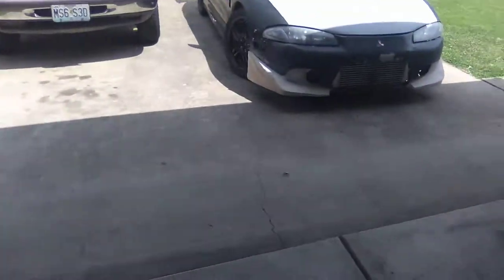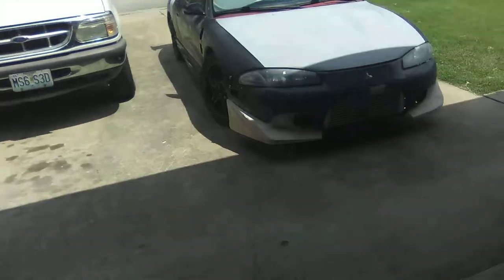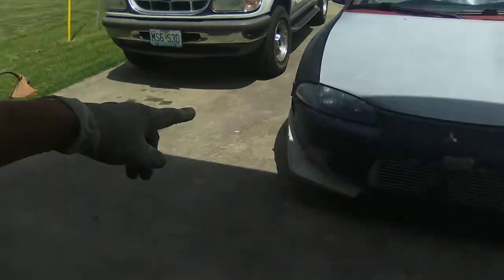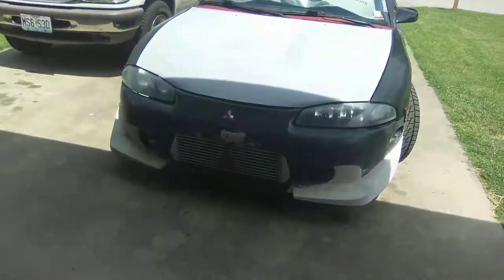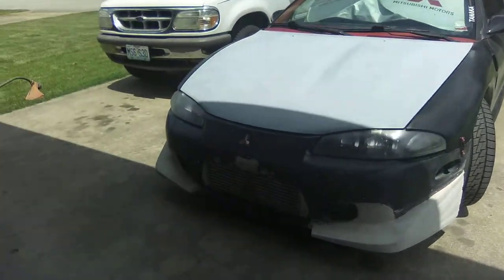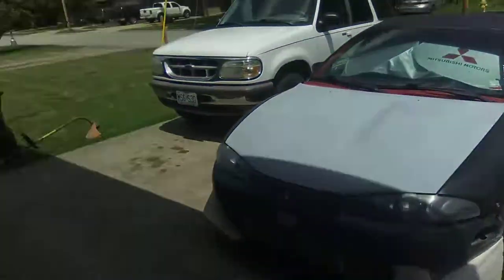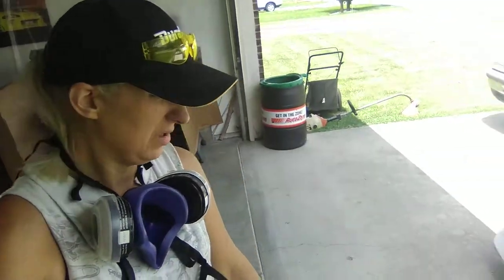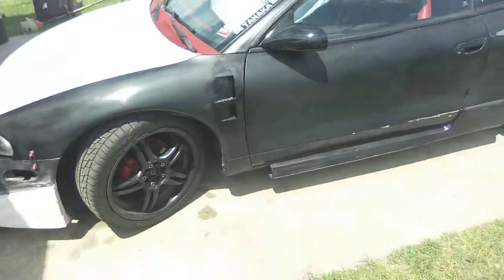There's my beauty sitting in the driveway. Yeah, she can't be in here while I'm painting. I like the front bumper. Amber busted her butt yesterday working on it. Started putting some bondo over the fiberglass side. She's still shaping and bondoing this side. It gets a lot of cracks in it when you just put the bondo right over the foam, so eventually you've got to put fiberglass on it, and then you can shape it some more.